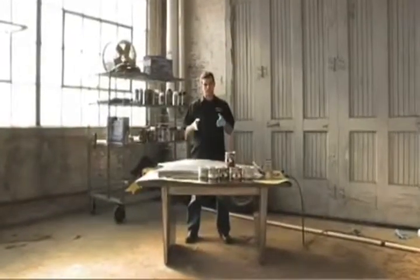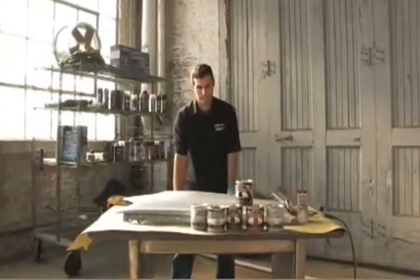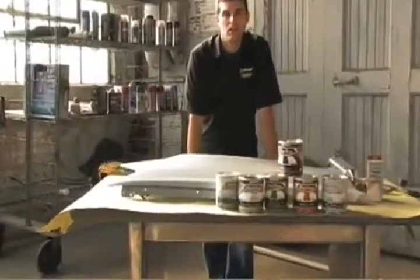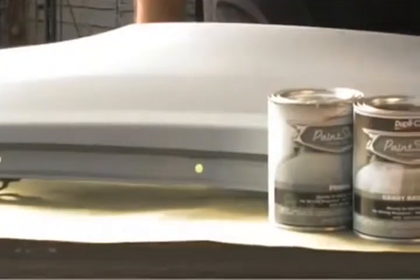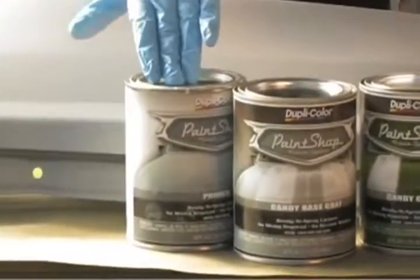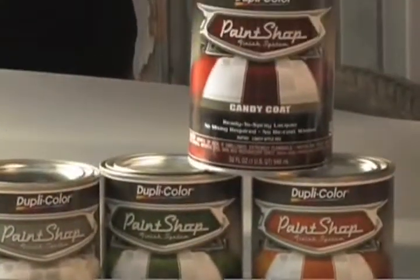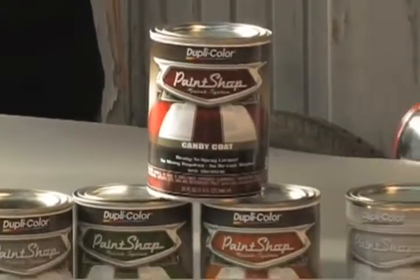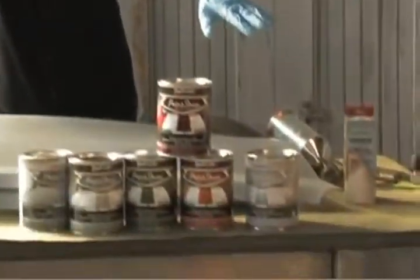In today's segment we want to talk about our Paint Shop Candy Coat System. If you're not familiar with the candy color, it's a deep metallic color. This is a cousin to the Paint Shop system. The Paint Shop Candy Coat System is comprised of the primer, the base coat — which is a silver metallic coat that gives the color the depth — one of three colors: candy apple red, candy apple green, or candy orange. They're translucent paints that go over that base coat, and lastly, the clear coat to finish it off.